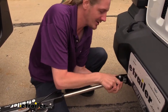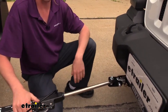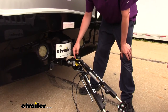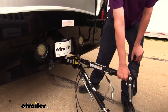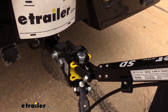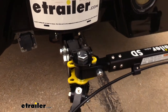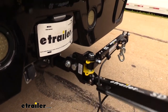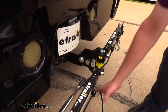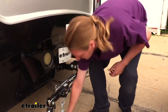I'm putting these in and out all day long, and it's just night and day on how I feel at the end of the day messing around with this tow bar versus the competitors. When you're done using your tow bar, there is a storage position. You'll see a small tab here on top, and these yellow hooks on each side will help keep your arms up — you can put one on either side. To store them, you just lift up on the arm to lower that peg down, twist it over, and then lower your arm down, and that will hold it in place. You can take your safety cables and wrap them around and clip them onto each other to keep those up off the road.